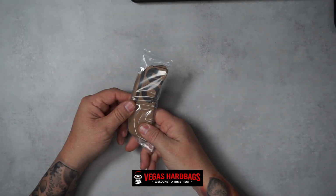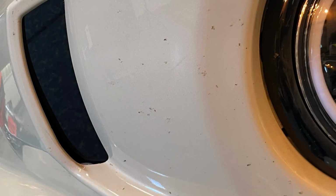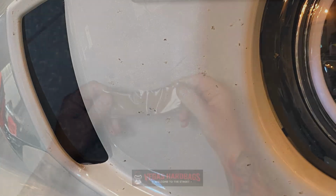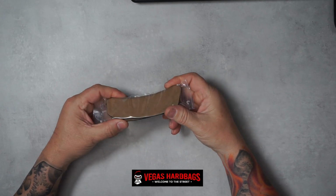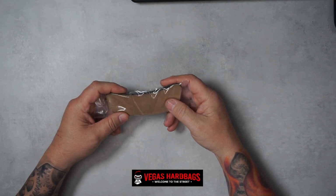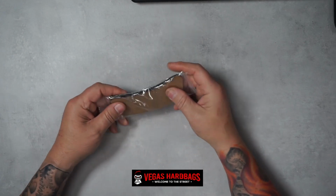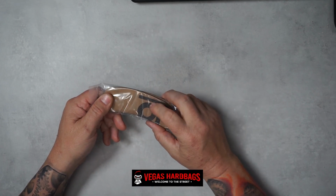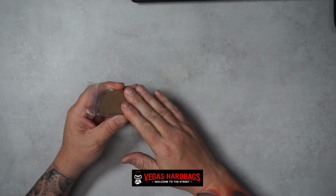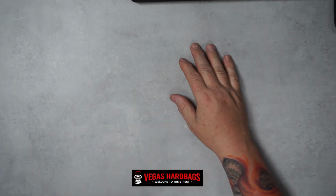These are the vents that get shipped. This is the only thing that I'm really, guys, disappointed in, and I couldn't come up with something better, but once you get the fairing off, you understand there's no way to make a physical, mechanical mount for these. So we're going to use some silicone to put them in those vents, and then let that dry. We're going to peel the brown paper off first. This is protecting the black acrylic underneath so it stays nice and doesn't get scratched during shipping. And then you'll let that dry, and then that will be mounted.